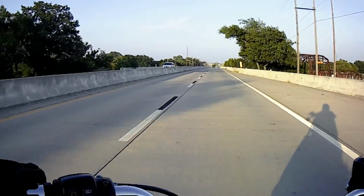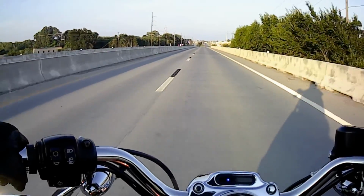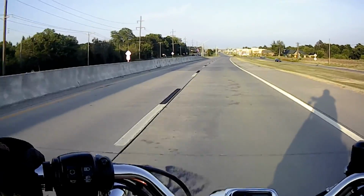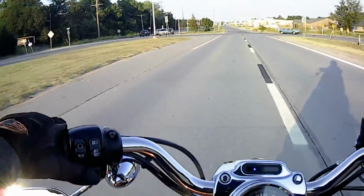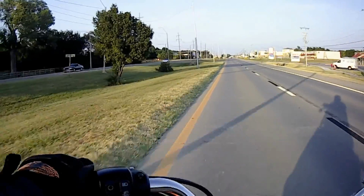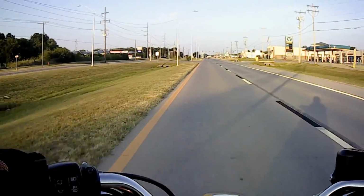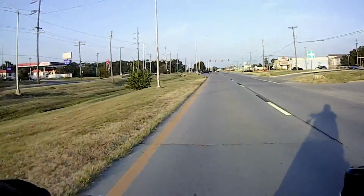So, the other part of this kit that really makes me wonder a little bit is the throttle body. This massive throttle body. I mean, it's like putting a twin cam throttle body on your Sportster. Now, the stock throttle body, I guarantee you, is going to provide your bike with more than enough air. Generally, people don't start porting the throttle body or looking for a bigger aftermarket throttle body unless you're doing like an 88 or 90 inch build, or any kind of bore increase, like going to a 1250, 1275, and you're going for that 120 horsepower mark.